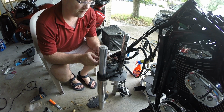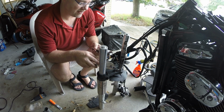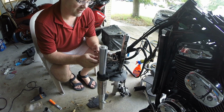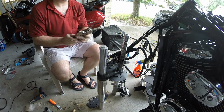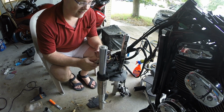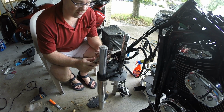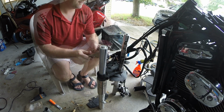Man, oh man, I'll tell you, if the pipe was just half a millimeter smaller in diameter, it would have fit on the inner race absolutely perfectly. But the taper of this first thread just touches that cage, so I didn't want to chance it. Anyway, we'll get this on now. So what I'm going to do off camera here, because I got this set up, is I've got the heat gun I'm going to put on the new bearing, and I'm going to very quickly transfer it over. So I'll have the camera set up here so you can see this going on.